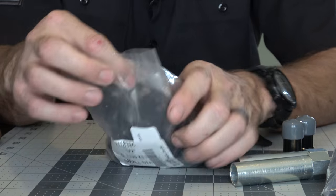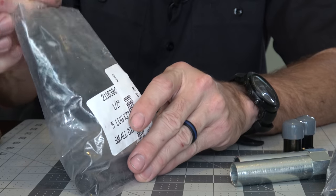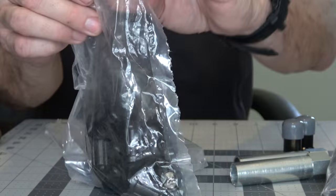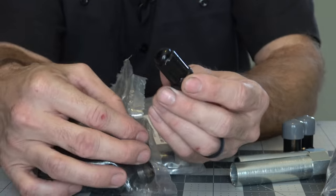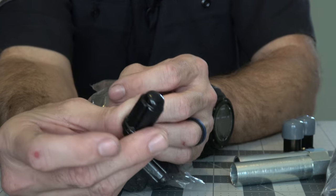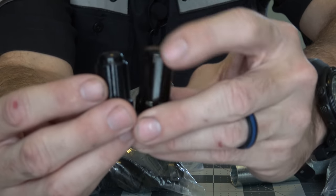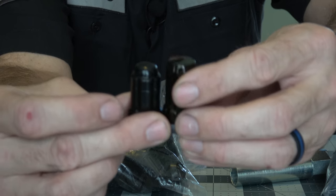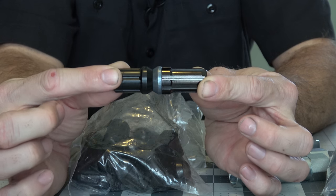The set I bought for my son was quite a bit cheaper - this is the Gorilla. Again, these are one half inch by 20 threads with a cone seat. They do not come in as fancy packaging and come with no instructions - pretty much no fuss, no muss, more of an acorn style finish look. The McGard has a flat top while these Gorillas have sort of an acorn top. It's a little bit shorter design. They both have the same cone seat.